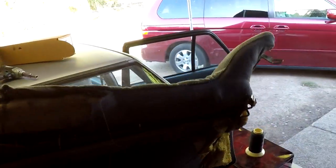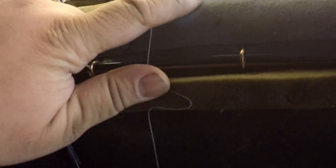It's just so nasty. Upon further inspection, there is a blue cloth backing right here before the actual fabric, and this whole left section does not have it — so it has probably ripped off and got brittle over the years. What I'm probably going to do after I finish sewing all the seams together is just put zip ties and pull the fabric all the way down to the metal rod, as a temporary fix until I find another back seat or the new owner just buys it without worrying about it.